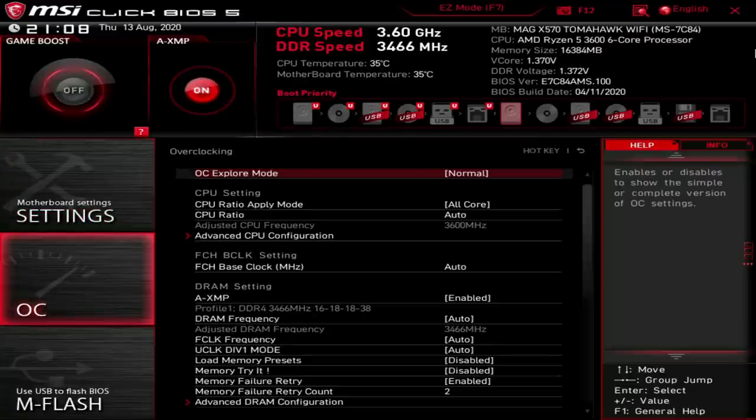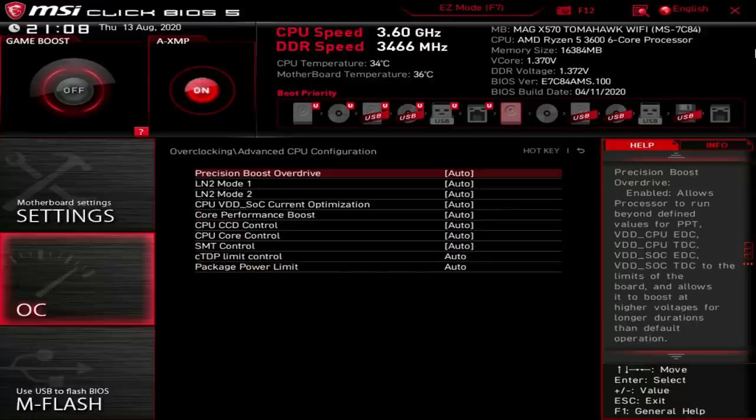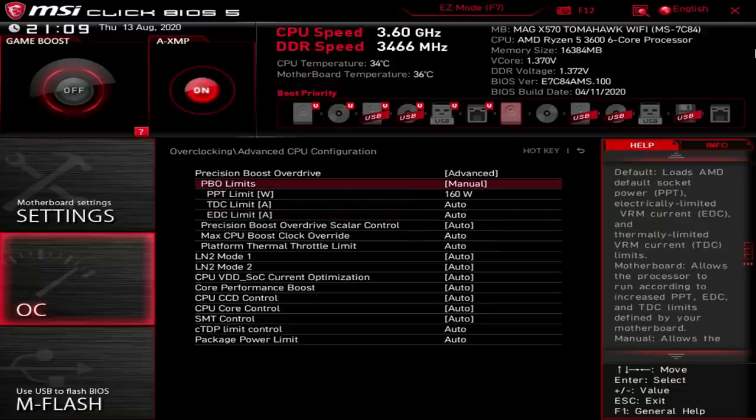So first things first, we need to figure out the FIT limits for the CPU and the cooling system. The cool thing about the FIT limits is that we're basically going to find out exactly where the limit is. If you don't have enough cooling, and the chip ends up running at 90 degrees or something, then the FIT system is naturally going to lower the voltage to accommodate for that really high operating temperature. Even for cooling considerations and everything. So if you had a better cooling system, the FIT will actually give you a higher voltage recommendation, because your cooling's good enough to take it.